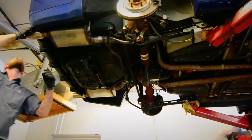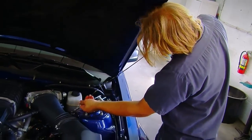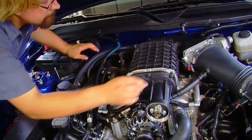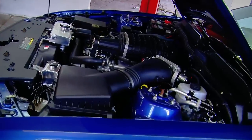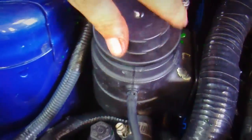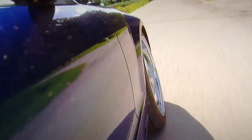Magnuson provides a new handheld SCT tuner to flash a new tune to the car. So you flash the new tune, make sure all your connections are tight, turn the key, pressurize the fuel system, check for any leaks. If everything seems good they ask you to start the car and run it for just a few seconds, make sure there's no weird noises, it doesn't have a misfire, then check for codes. If everything's all right, start it up and let it warm up, make sure you've got coolant flowing and the intercooler is bled out — after that you're ready for a test drive. We noticed a dramatic improvement the first time we drove the car after putting it all back together.